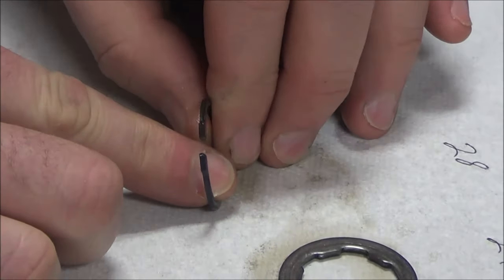On this gear they often sell just the bushing separately. If the gear's good and you just had a problem with the bushing because it's a soft metal — when this bushing's good, there's not a ton of wiggle room. They don't give you a measurement, they'll just tell you to check it out. All of these with these bushings will have some of this. A little float is pretty normal. If you can move it all over the place, something's wrong — you should not be able to rock it really out of contact with the other gear. When you get your new one, rotate it because sometimes there's high spots on the bushing and you basically want to mate them together.